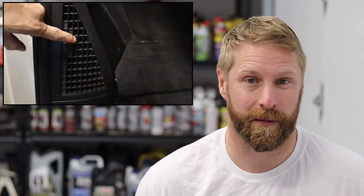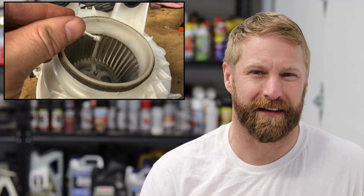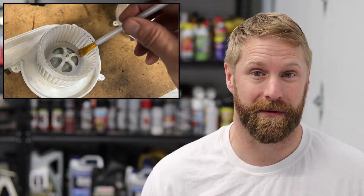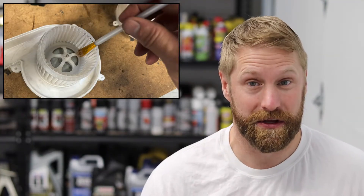Real quick and easy — well, the job does take some time. But if you have a CT200H by Lexus or a Prius by Toyota, your hybrid battery does have a fan. You'll notice this little vent in the rear of the vehicle — that's just the entry point. You've got to get down into that fan. The fins often collect a lot of dust, debris, and buildup over the years, and that probably takes quite a bit away from your hybrid fan efficiency. This is a maintenance item that's not really covered anywhere, but it's something you should do on a fairly routine basis. And if you have not done it on your car, it's probably time to do it.